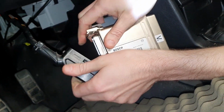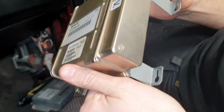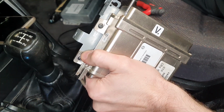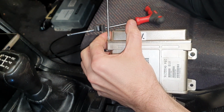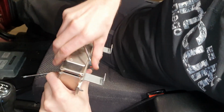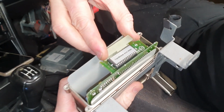Just as we did on the box that controlled the fuel, we also saw some marking on the screws on the golden box. This tells us that someone might have opened this box before too. The reason people pay extra for these golden boxes is that on these boxes you can easily change the standard chip to a tuning chip. On the other types of ignition boxes, the chip is usually soldered in place. And just as we expected here, someone has mounted a tuning chip here too.